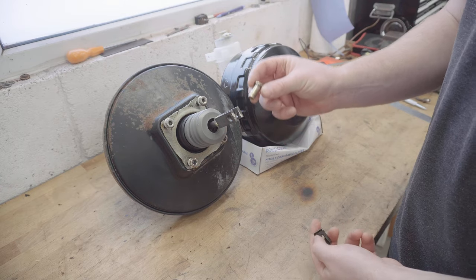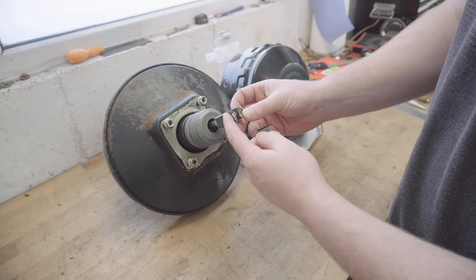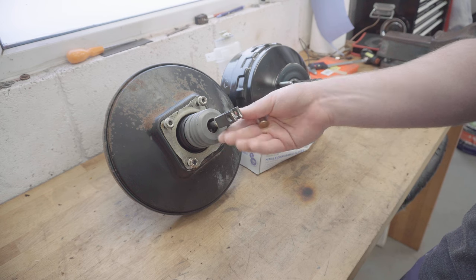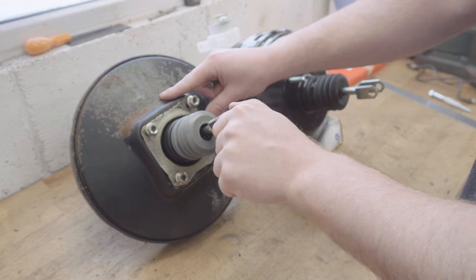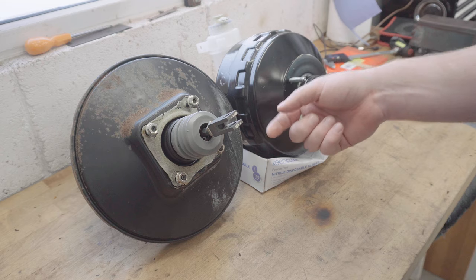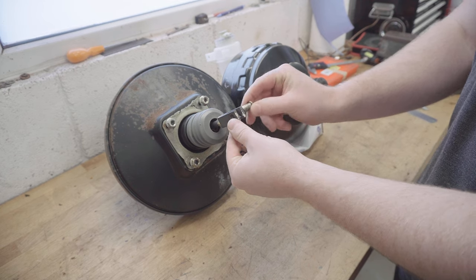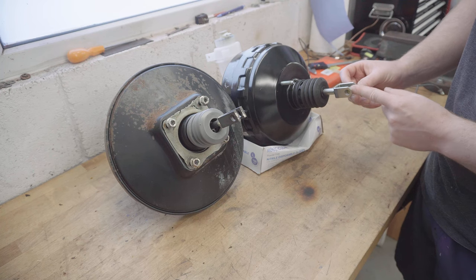I've just grabbed the clevis pin from inside the car and its retaining clip — the pin goes through here and the clip goes on to keep it in place. On right-hand drive cars, because the brake booster is on the passenger side, there's actually a linkage which connects between the driver's side footwell pedal inputs, transfers it to the passenger side footwell and into this booster. So it's a little bit different between right-hand drive and left-hand drive cars. On right-hand drive cars the clevis is actually this way up to work with the linkage. Whereas on left-hand drive cars there's literally an L-shaped bracket on the side of the pedal which attaches with this pin. The clevis pin is M10 size — a 10mm hole basically. Unfortunately because the fork is wider on the E90 booster, it's just not long enough to come through the other hole, which is the first problem.